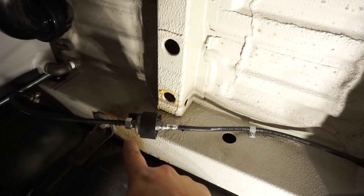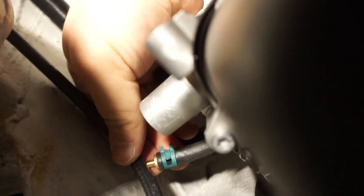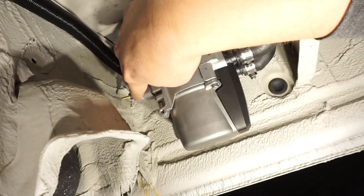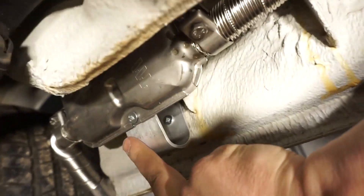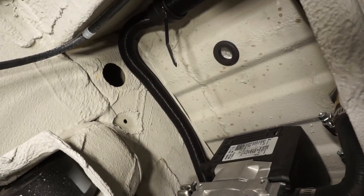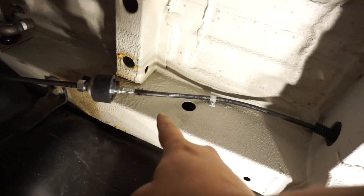You can see our fuel line coming from the fuel pump running all the way across and around. I'm not going to hook it up to the heater yet — once we get power we'll need to purge it, so that'll happen when we get to the wiring. For the exhaust, the full exhaust and muffler system from the kit clamps into the diesel heater, comes down and runs underneath the frame with nothing touching the muffler itself. We made a custom bracket to fit it all in, and the tip exits down by the rear tire. A hole with a grommet is also in place for the wiring harness to come down and plug into the heater and fuel pump — but that's for the next video.